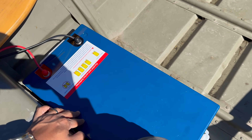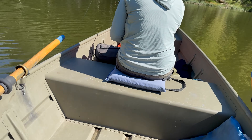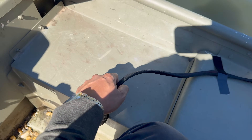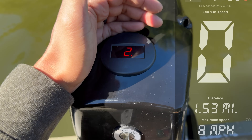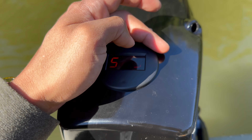Here's how I have the battery currently mounted — it's just sitting in the middle of the John boat. This is a 12 foot by 36 and I just have the battery harness running along the left side connected to the outboard. I've been running it for a little over a mile and a half so far and we are maintaining a voltage of 52.5 volts.